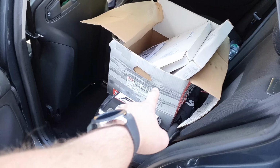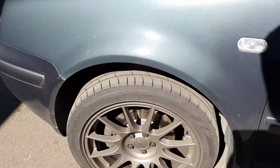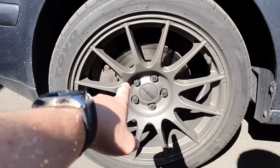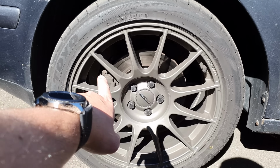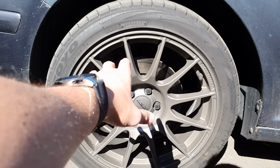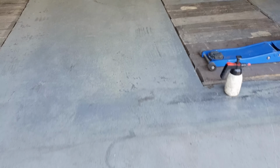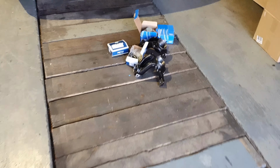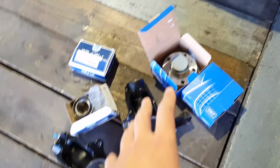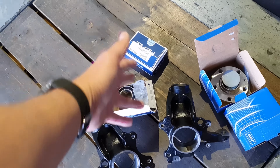So, big brake kit on the front. The problem, however, is that it does not fit the knuckles which come on the PD100 engine that I have here. On a PD130, which George has, that's no problem. So we had to get knuckles from a PD130. That's going on as well, together with new bearings on the rear, since we're doing it as well.